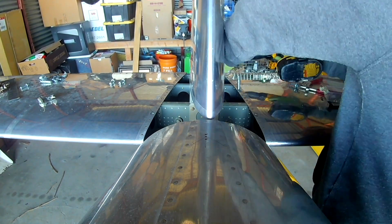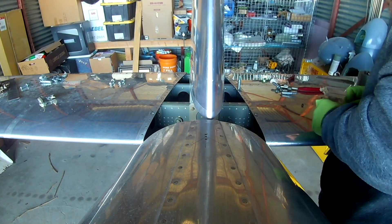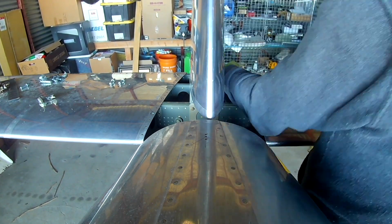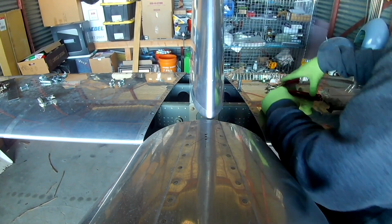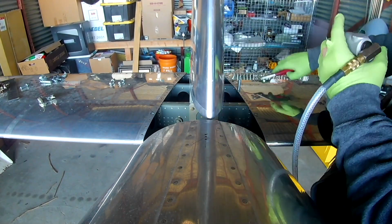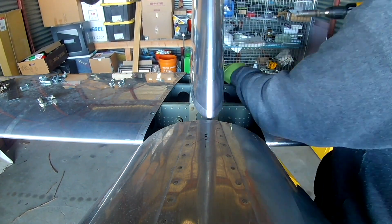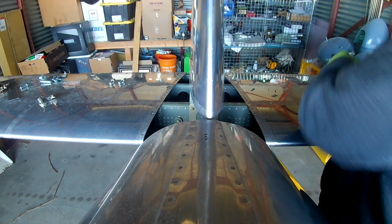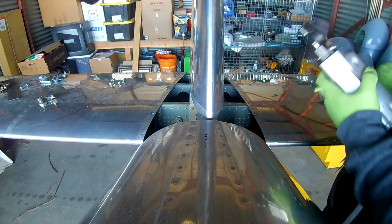In this case, that's not where it leaked — it leaked from all around the housing because I didn't torque the housing down. You're supposed to torque the housing in and then safety wire the bolts in place. I didn't do it, simple as that. So that's why after about 85 seconds I just started getting rained on with fresh oil.